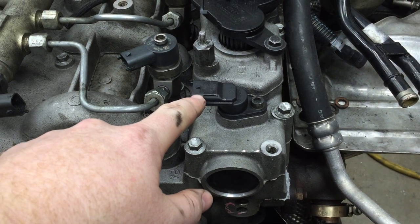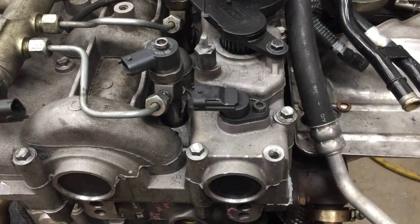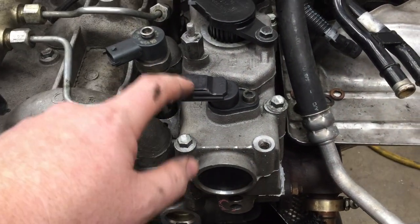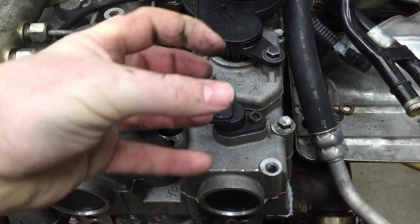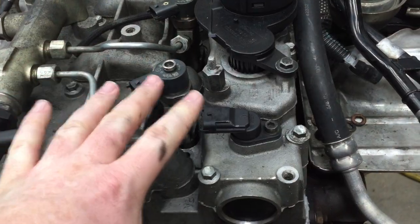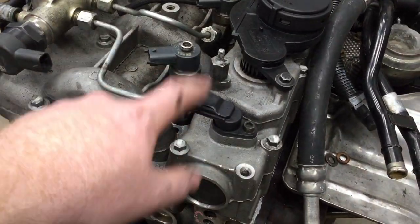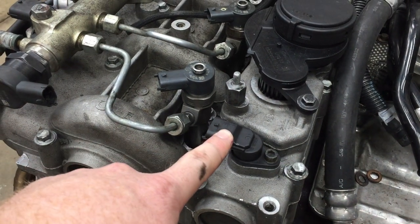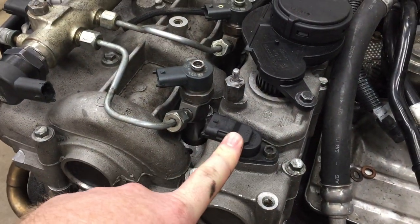The classic symptom for one of these failing is: you drove to the store with the engine warmed up, shut it off, ran inside for 10 minutes, came back out, and it wouldn't start. You sat there for 20 minutes, tried to start it again, and it started right up. That's because the sensor got hot, heat-soaked in the parking lot after you shut off the engine, and failed. Then you waited long enough for everything to cool back down to where it worked again. It can also just fail suddenly while driving — no gradual heat failure, just done — and you won't get a check engine code off it. There are two different sensors: the cam sensor and the crank sensor.